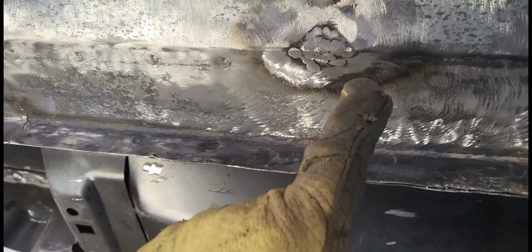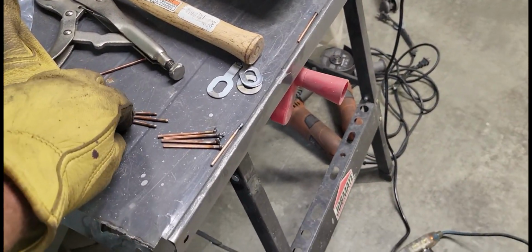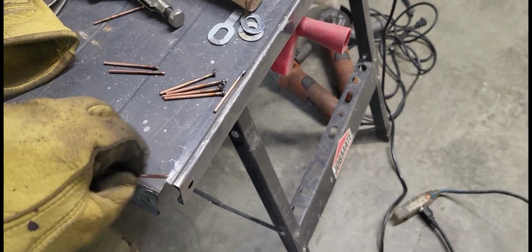Okay, this is not going at all the way that I would like it to. Welding the studs on here with the welder is okay, but it pulls the metal in by welding it more than it pulls it out by hammering on it. And then as well, the pins end up getting thin and snapping off before the metal moves very much.